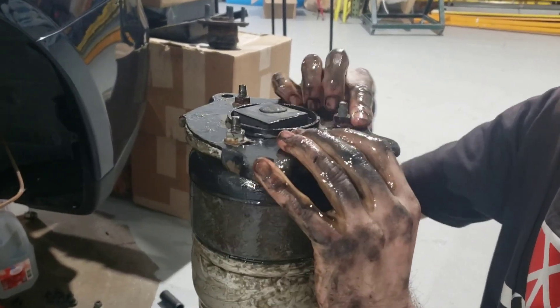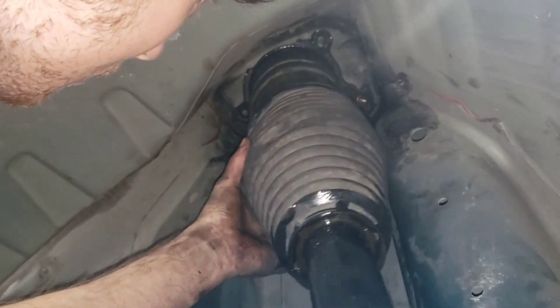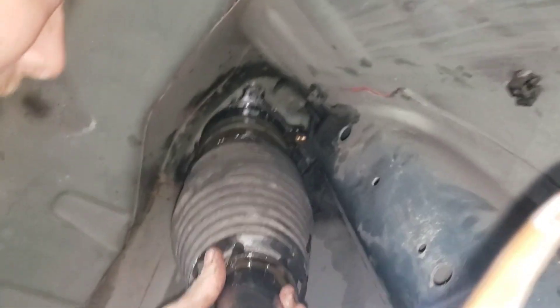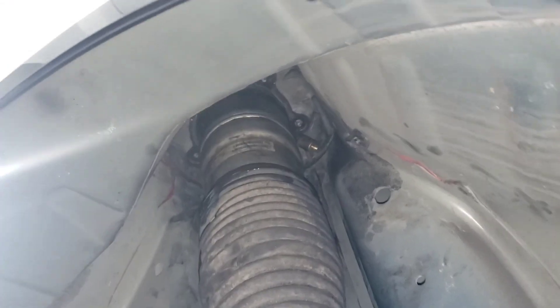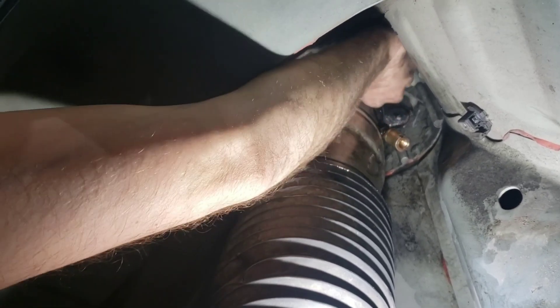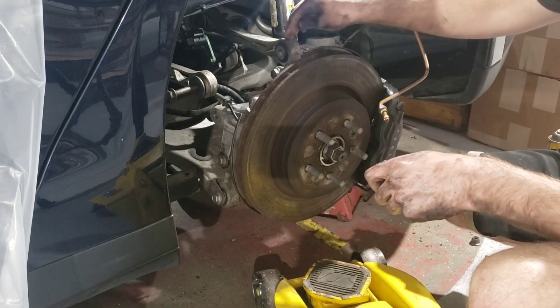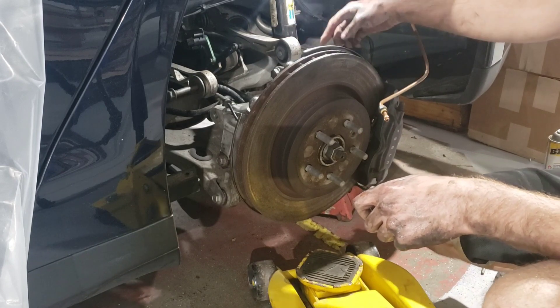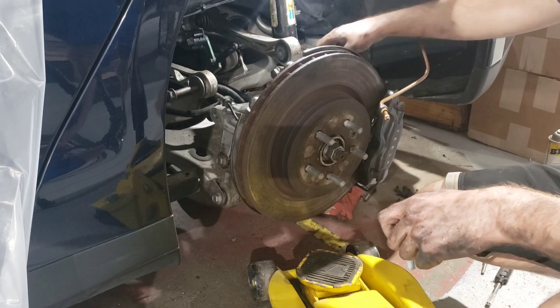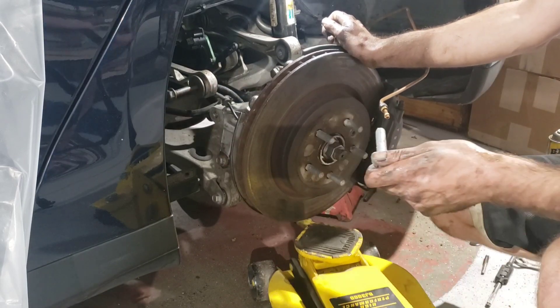Make sure to get the surface of the top part of the shock, because that's what's going to be contacting the frame of the car. Now we're just trying to bolt in the air suspension — first, get them loosely started. We're going to lift from the lower part of the rotor and jack the suspension so that we can get these two control arms up here. We already first put the bolt through the shock attaching it to the hub, and now we're going to lift it up so I can attach the two bolts here. So we're going to jack this up.